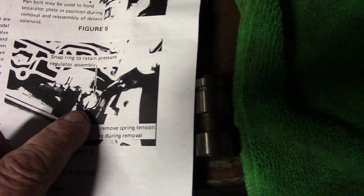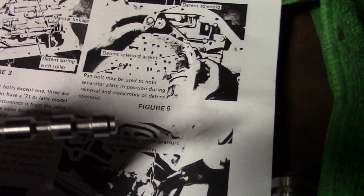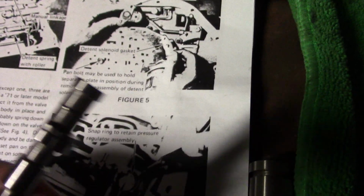So here's the high pressure valve. That'll be the modification in the transmission. We will remove the snap ring. We will replace the spring, whether it's a slide spring, the brown spring. You have to modify the valve under said plunger. You grind the valve flat, like so.